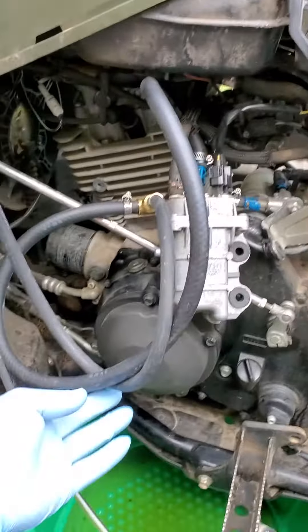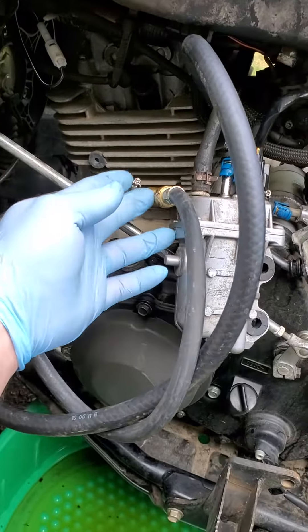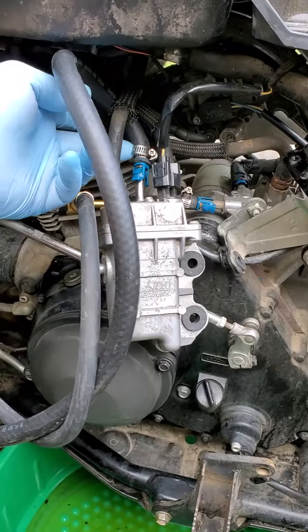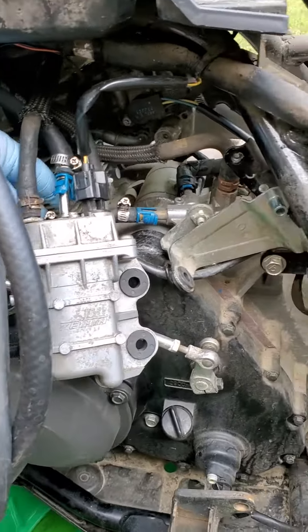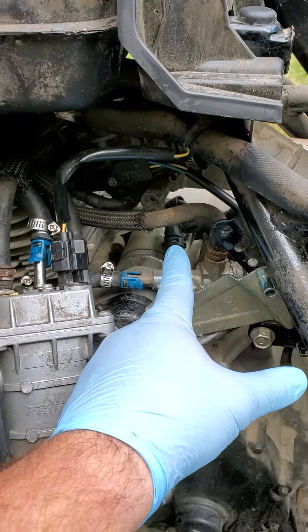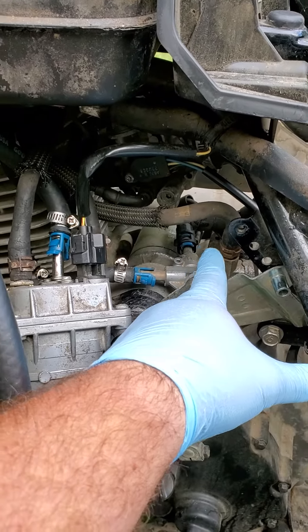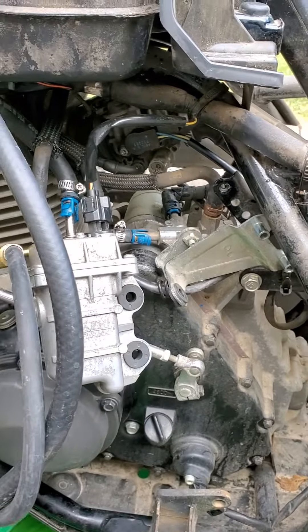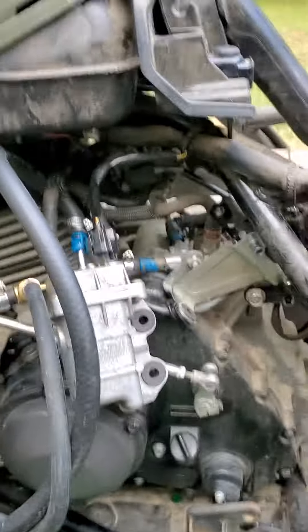The fuel line is twisted around right here — it goes up and into the tee. The back side comes directly off the top of the pump, then goes through the tee to the regulator, out the back side, up to the fuel injector. It also comes off the top for the overflow or over-pressurization.